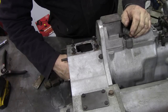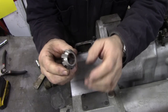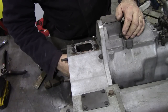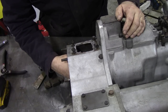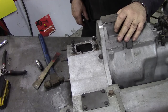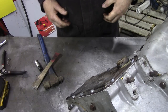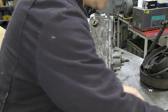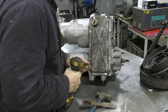The dismantling tool has overcome that problem. This is the nut we're talking about - you need a special spanner usually to get that off. What people usually do is just flog them up with a chisel, which isn't really acceptable. Spinning it around, we'll get the sump off. Oh look, somebody's put UNC bolts in there. They're quarter UNC, which should be the same size as a quarter Whitworth.